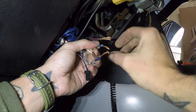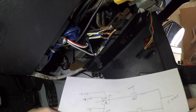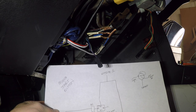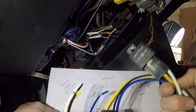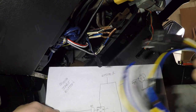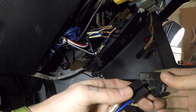There's the ignition coil wire, the start wire, the radio accessory wire, the two white constant power wires, and the main systems wire. Now strip off enough wire to make a good connection. Now that we have all our wires stripped, we can start connecting our relays. Luckily I brought the diagram with me. The first order of business is to take one of the white wires and connect it to pin 30 of the accessory and pin 30 of the run circuit — those are the two four-pin relays.